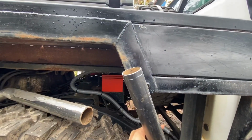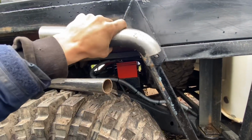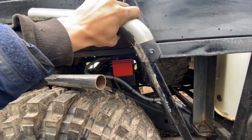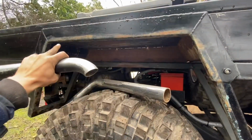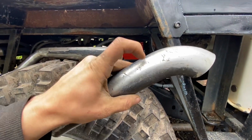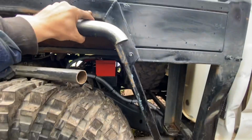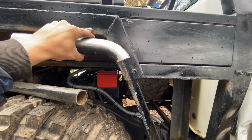And for that up there, obviously I've got this next angle. So I cut that off just square, as in square to where this tube's going to be running down. I've marked the heights of where the top of this will be. So I just eyeball that with the height, and then I hold this bit up and scribe the length for that. So then I'll just tack that